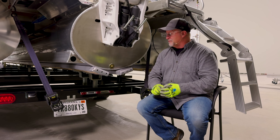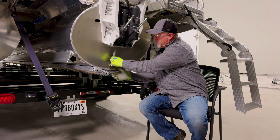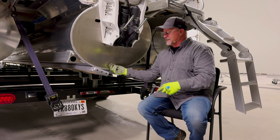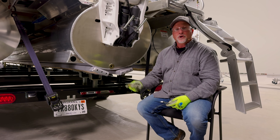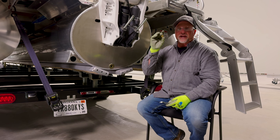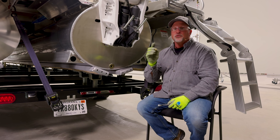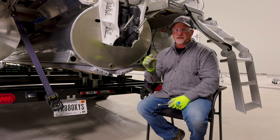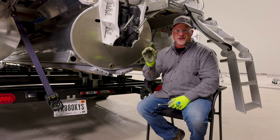While we're here at the back of the boat, some boats have a drain plug on the back of their tube. We're going to want to make sure we pull this out, and if it's on a trailer like it is here, we want to crank the trailer jack stand up high enough so the water will flow out. Once the water has flowed out, take your drain plug, put it in a baggie, and zip tie it to your steering wheel. Make a note on your checklist to put this back in in the spring, because we do not want to put the boat in the water without the drain plugs — that would be a bad situation.